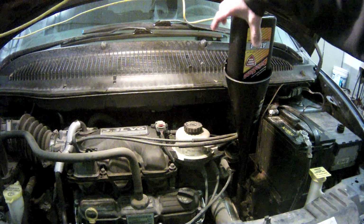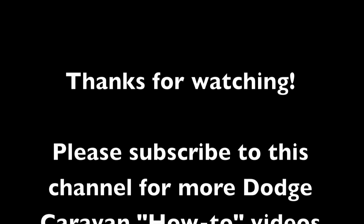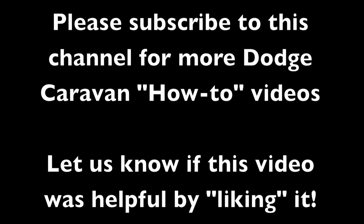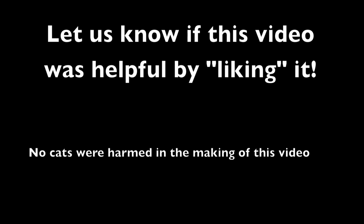Apply the brakes and cycle the transmission through the gears. Then, with the transmission in park, go back and check the fluid level on the dipstick. Add more fluid as needed, check for leaks, and lower the vehicle back down to the ground. If everything looks good, run the engine for a while to warm up the fluid, then cycle the transmission through all the gears and check the fluid level one more time.